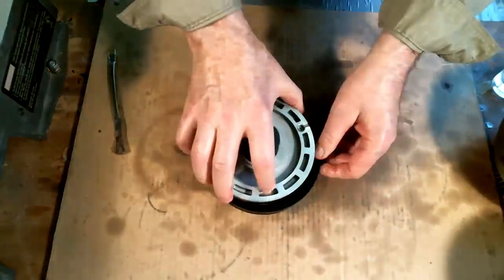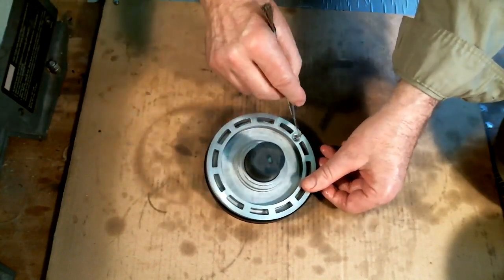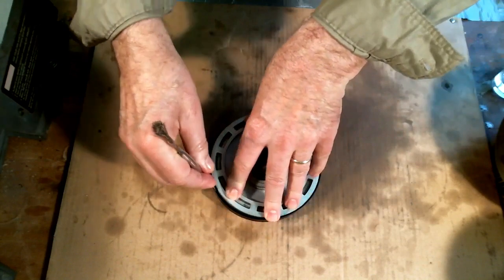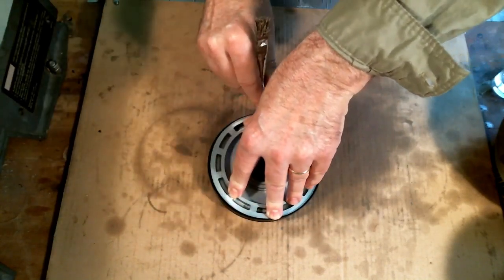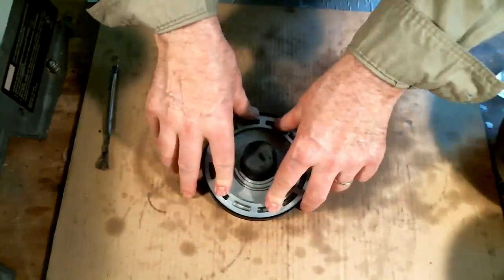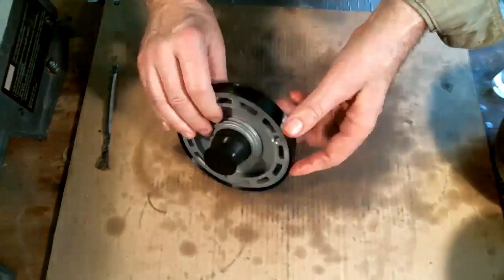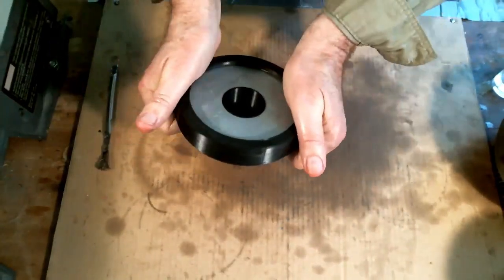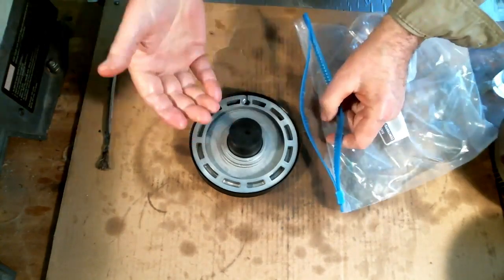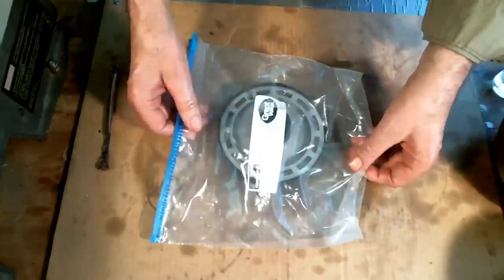Just like with the C6, I've got to put the piston lip side down into the tool, and I'm going to have to kind of help it along. You can look down in there to make sure that the lip is not hanging up on you. It looks like I just about have it — there we go. Make sure the piston is all the way against the bottom of the tool — that looks good. Also make sure the center didn't pop out on you while you were working on it — that looks good also. We're going to put it in the tool facing up.